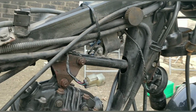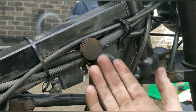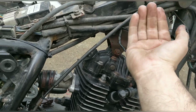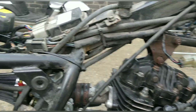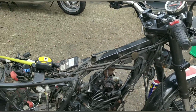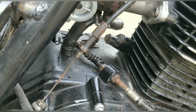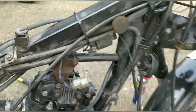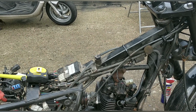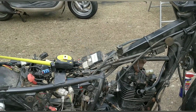I mean, I'm looking at it. You could come down here, but I think it's going to look a bit silly. Could you come down here and under the tank and just get away with it? Maybe. I don't want to mess with a tight throttle cable once you start turning left and right. No good. So you need a cable that, this is 90 roughly, 86 to 90. I want kind of 120, and then I think we'll make that work. 120, 130 centimeters, and that will work. So let me get online and see what's there.